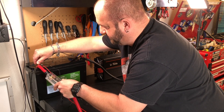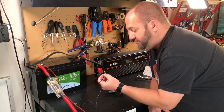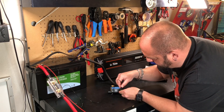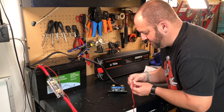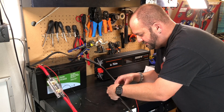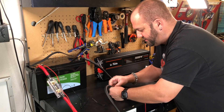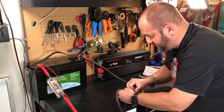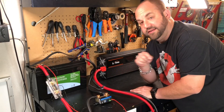Also take the black ring terminal — that's the temperature sensor — then the battery positive cable, and screw that all in together. Take the two black wires and insert them into the V battery plus and the AUX inserts. Take the red wire and plug that into the other V battery plus. Then the other side goes to system minus, which is to your load. I'm going to use an inverter for this, but if you're just hooking up a 12 volt system you can connect whatever load you want.